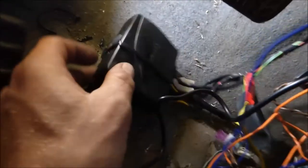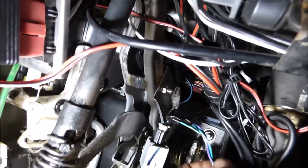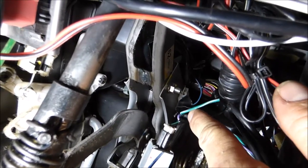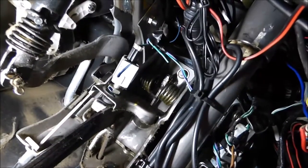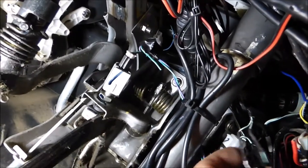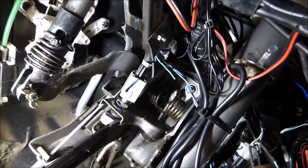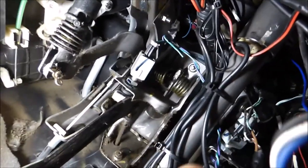As you'll see, that's your clutch pedal sensor, and that's your brake pedal sensor there. The clutch will be your purple and green. Your green is not connected to anything — you're only connecting your purple one. Your purple one is connected to the green wire on the brake pedal. And that will go part of the loop. You've got your brown and brown, so you'll have your two browns connected. Your brown with a white trace is connected to your white with green trace, and the green with white trace is just connected to your solid brown wire. And that's on your brakes.